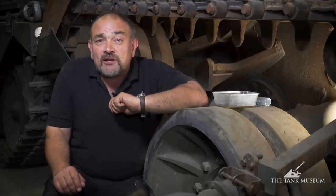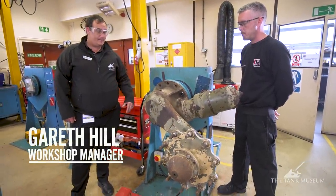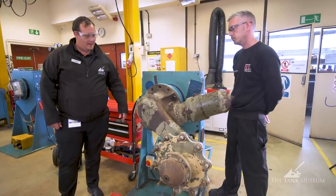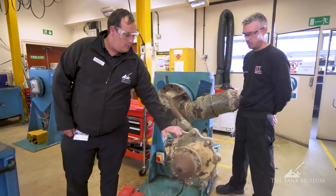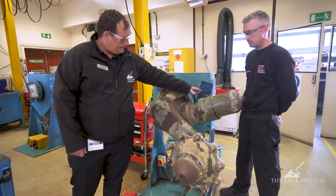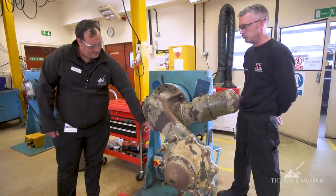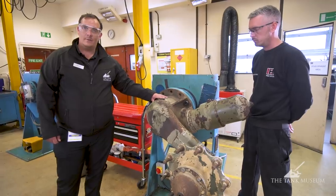This demonstrates how the principle of Hydrogas suspension works. This is one of the Hydrogas units currently about to be serviced, on a jig that allows the unit to be rotated — making working on it much easier and safer in terms of manual handling. The components are: the main suspension arm, the hub assembly that the wheel rotates on, the bottle containing nitrogen gas, the cylinder in which the piston runs up and down, the main body housing the crankshaft and main shaft, and the sump underneath. Steve is going to be doing the service on this unit.